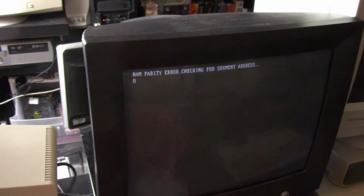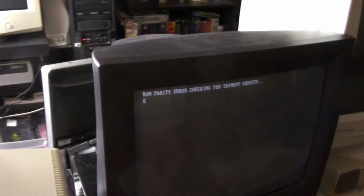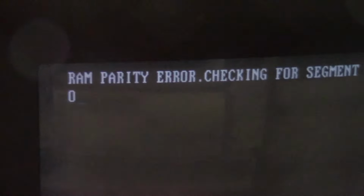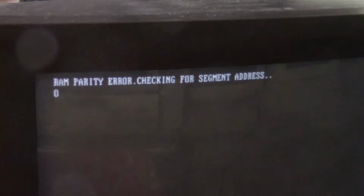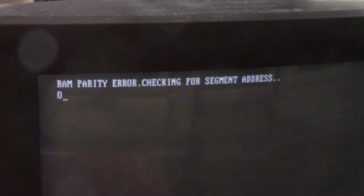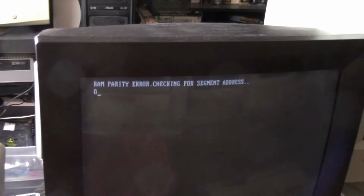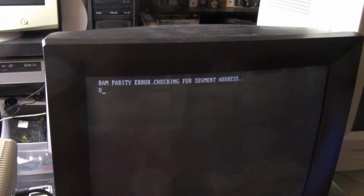So I was doing more testing, and I was trying different VGA cards to make sure it wasn't messed up memory or something on the video card causing the issues. And I ended up getting this error, and the computer locked up, so this is really pushing me in the direction. I really think, unfortunately, that it's some kind of memory error with the onboard memory.